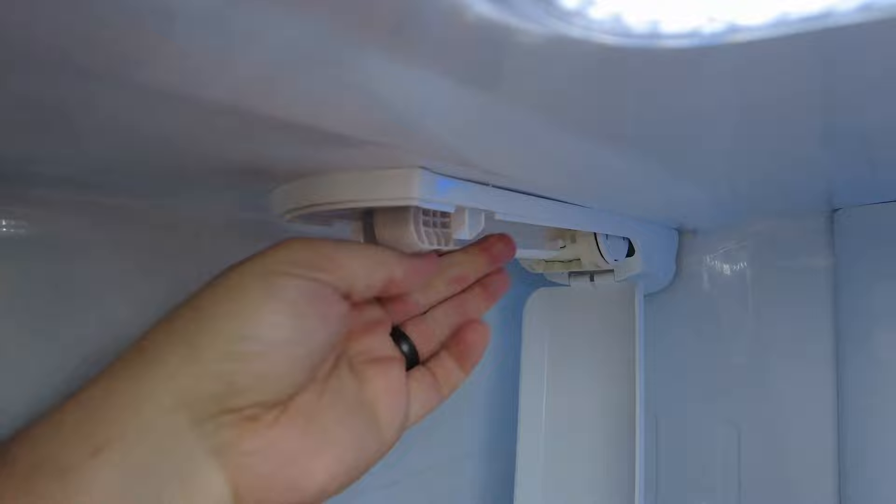In my case, I wanted to just remove the filter, but some refrigerators will actually stop dispensing water and ice if you don't have a filter installed. The alternative is to install a filter bypass plug. If you have this installed in place of the filter in your refrigerator, it's going to continue to work and you won't have the problem of excess carbon from the reverse osmosis system clogging up or ruining your refrigerator.